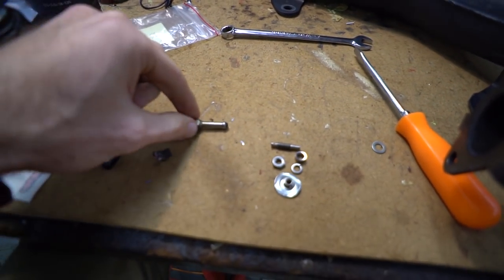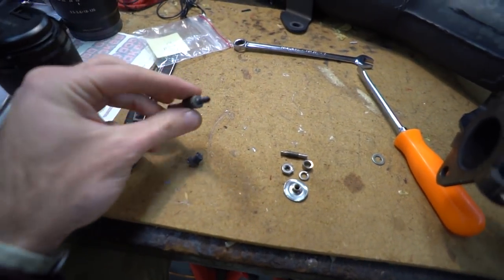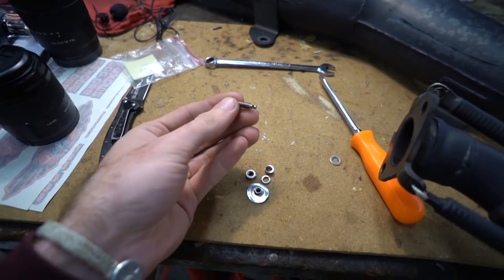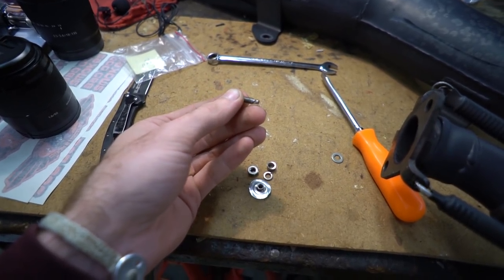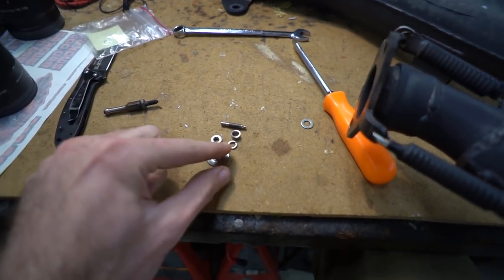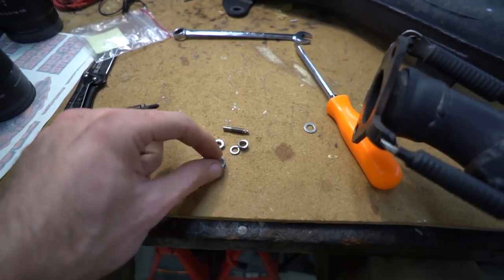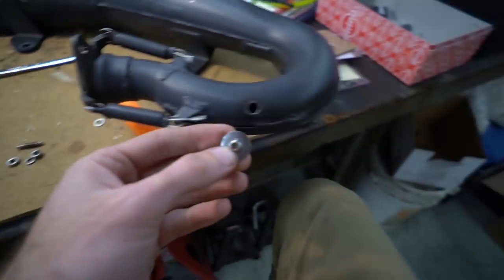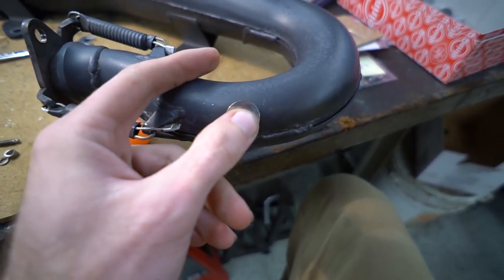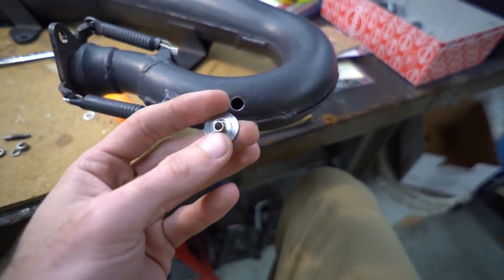Here's a quick overview of all the parts. This is the rivnut that I drilled out, this is the original injector nozzle nipple, and this is the new one — the new tiny little streamline injector. It's got a pinhole at the end and you can see this notch cut out is for atomizing and turning the oil into a fan spray. This is the hardware you're given to mount this nozzle in place of a rivnut. The only issue is my hole from the original rivnut is too big for this new setup.